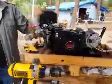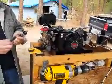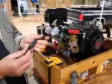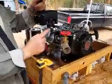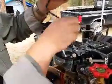So let's say that you suspect your spark because your engine won't start. One of the things that makes this real easy is a spark plug tester — a unit that we bought down at the automotive parts store. What you do is you take the spark plug cable off. It's got a little handle here, you pull that off and you can see the top of the spark plug. This fits in between; you take the little boot with the female side and stick it all the way on until you can kind of hear it clip, and you're solidly on the spark plug.